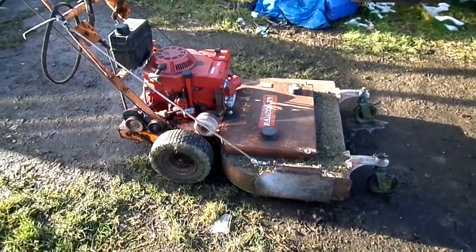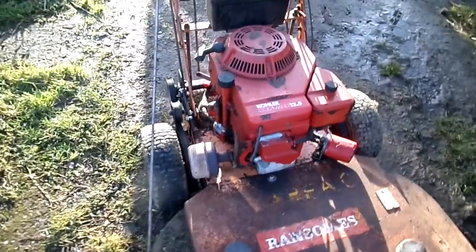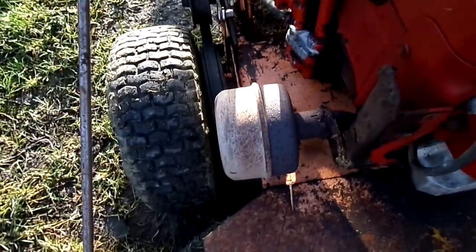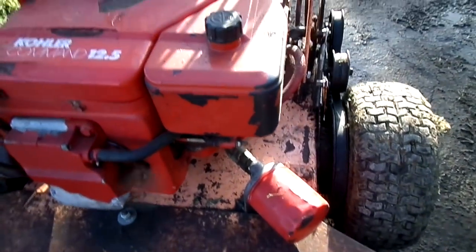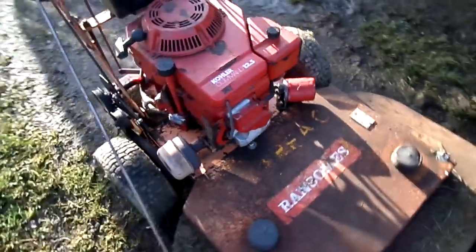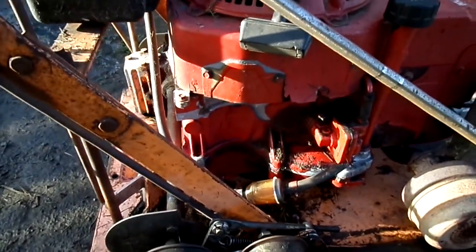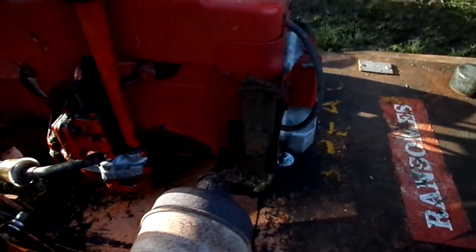Let's have a look at some bigger machines — more commercial mowers. If I was going to tip this one over, I wouldn't want to tip it to the side because it is too heavy. Ride-on mowers are the same. There is the oil there, exhaust side, coming out of the exhaust. Air filter and carburetor are up there. But on these, you don't do that — you flip it up, you do a wheelie, because you want to tip it so all the oil goes into the back of the engine, down into the crank. You don't want it going the opposite way.